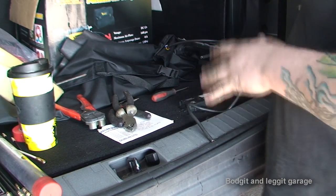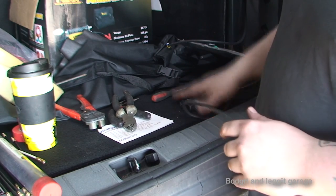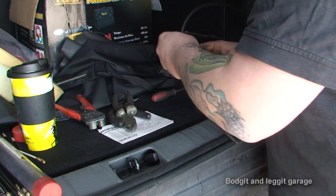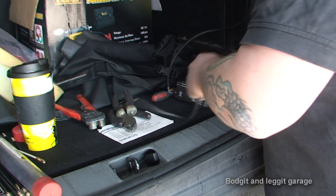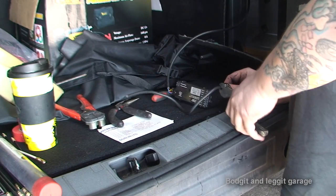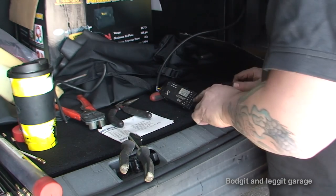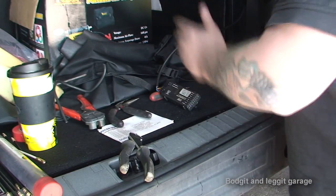This is day two - I have the parts I need. I've got the scotch locks and this is the wire coming from the battery. What we're going to do is wire in the part coming from the box to the car's electrics. Once we've done that, we'll plug in the two wires from the battery and then that's our tow bar done. On cars, the wires are not going to match the same colour as what you get in your tow bar, but all the tow bar wires are always the same.